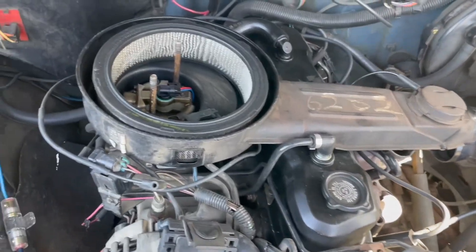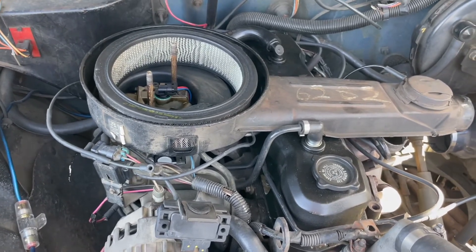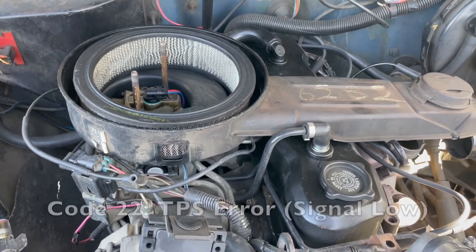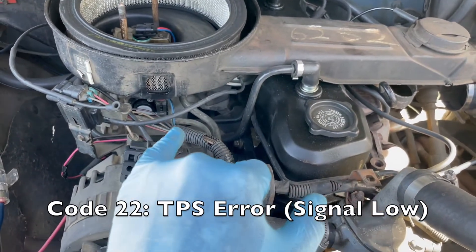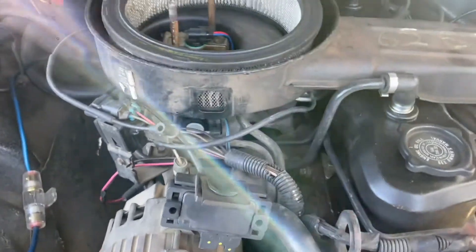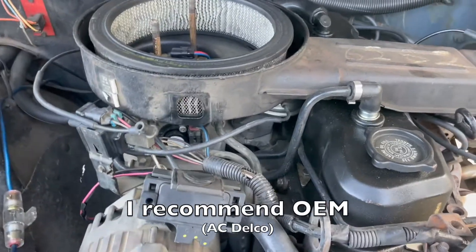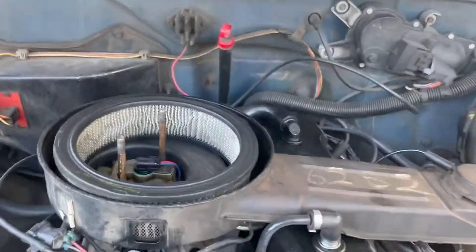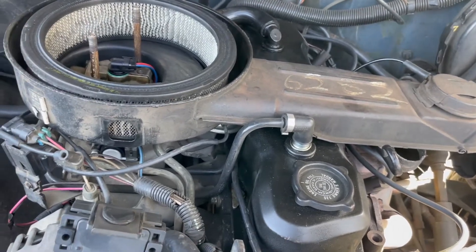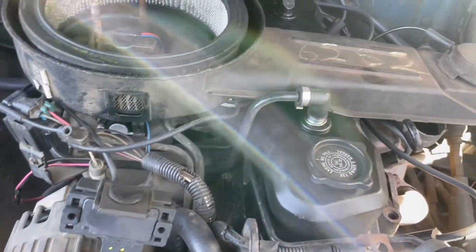What's up y'all. I've been having a couple issues with my truck for the past few weeks — minor sputtering and misfires here and there. After doing a couple code diagnostics, I found a code 22, meaning there's no signal from the throttle position sensor to the ECU. I was kind of ignoring it for a couple weeks because I recently replaced that part, but I didn't get an OEM part. A couple days after ignoring it, my check engine light started flashing, and at that point I figured I had to figure out the problem immediately.